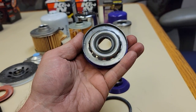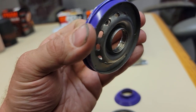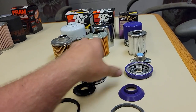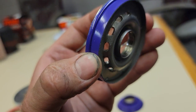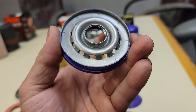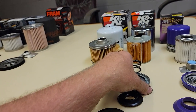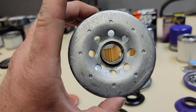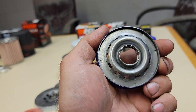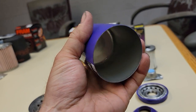The bypass filter is old-type technology, nothing too new. They do have a heavy-duty end with a lot of oil holes for flow. The threads are super super thin on these. A lot of people have complained about the threads — if you look at the threads you can see how much more robust and defined they are on the K&N. The threads on the Royal Purple are like super super thin. The thread insert area is just super thin; there's not very much there at all. Where the K&N has double or triple the thickness and a lot of thread support. The Royal Purple one is tiny — super thin, there's not a lot of thread backing. The can strength is pretty strong though; it's not a super thin can, so they do have that going for them.